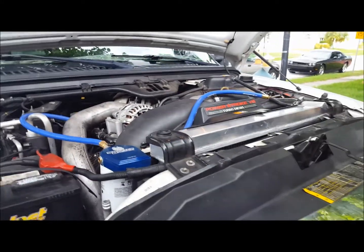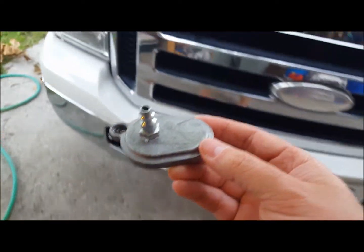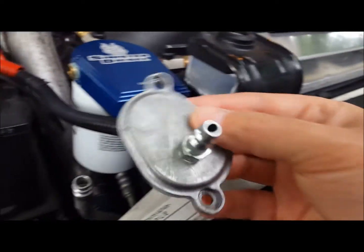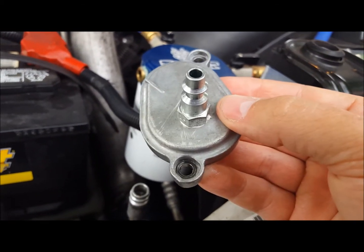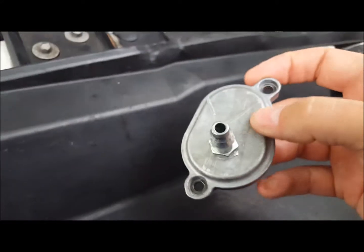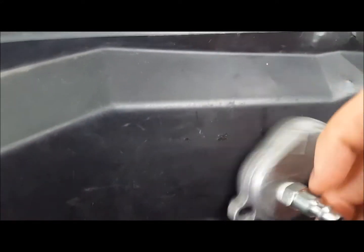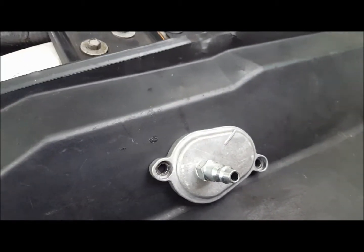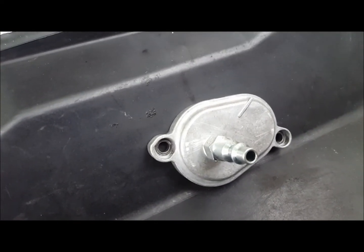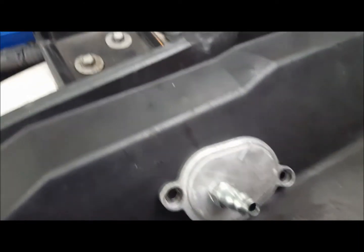Part of it was pretty difficult. There are only two screws — the one closest to you is easy to get to, but the farthest one sits underneath the turbo. I don't know how shop guys do it; I guess they could take the turbo off. There are two harnesses down there and one will be in your way, so I used a clothes hanger to pull it out of the way a little bit.